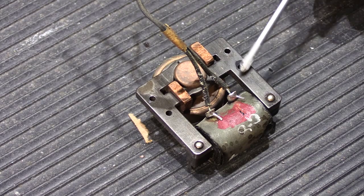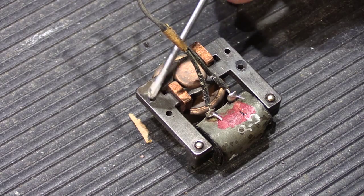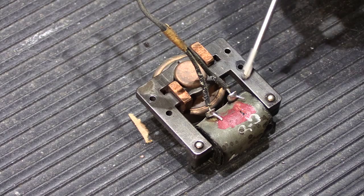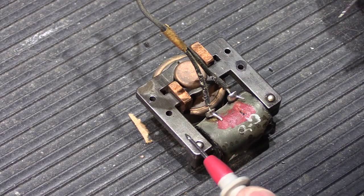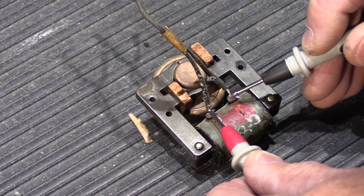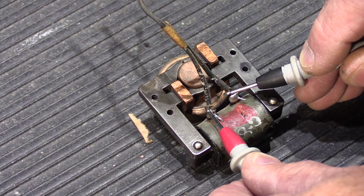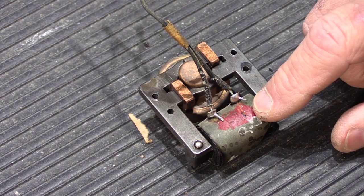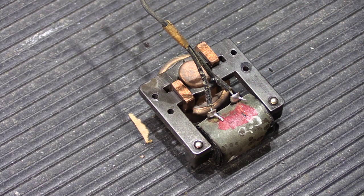What we have here is what would be more typically referred to as a skeleton motor design. The skeleton refers to these metal plates that are riveted together, with the coil through the center of the plate — this creates the electromagnetic field needed to run the motor. The first thing to check is whether the coil is good. Using an ohm meter across the two coil terminals, we're getting about 11 ohms, which I believe is about what it should be, so the coil is good. If the coil were bad, you'd have to find a replacement motor to rob a coil from, or rewind it by hand — which is tedious and may make repair uneconomical.